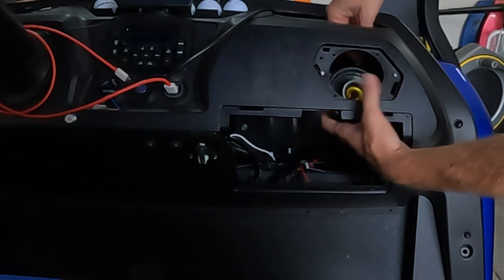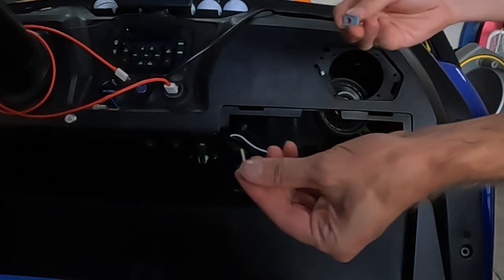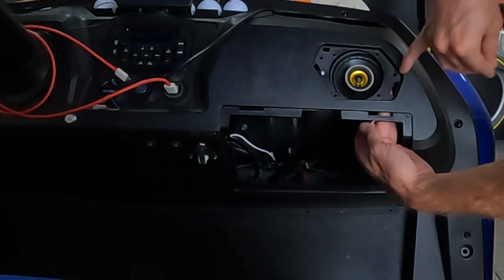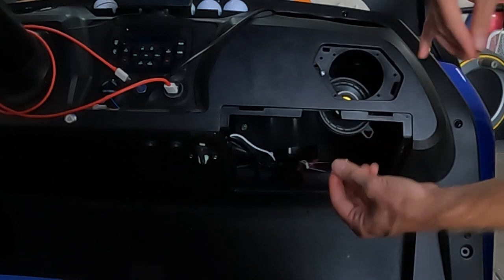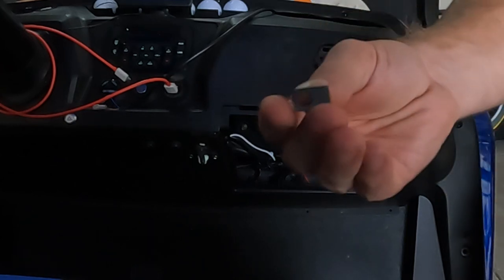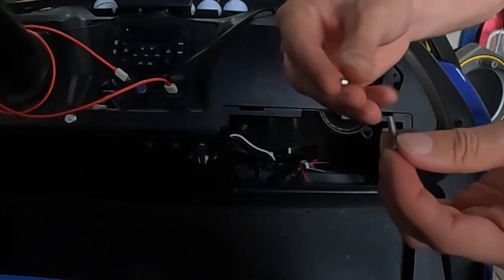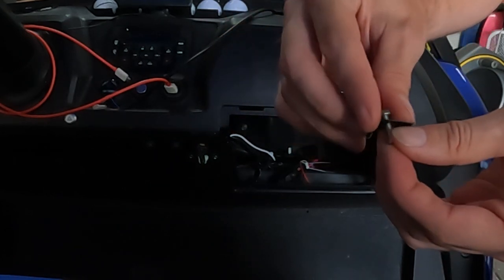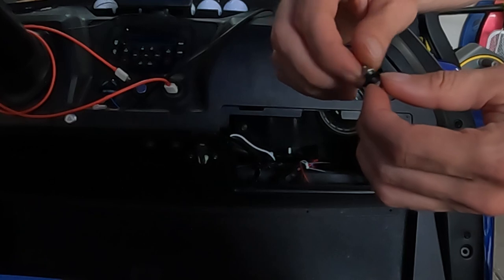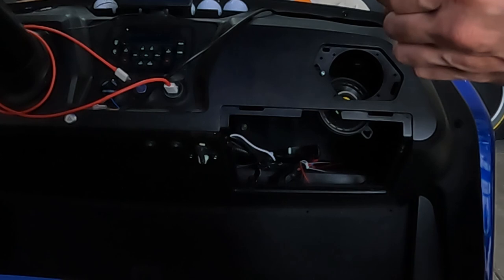What I did here: I have the screw and I rear-mounted the speaker. This is the hole that's already there. So the screw goes through the dash, through the speaker. I broke the clip in half that comes with it intentionally, just so I could use it as a washer, and then put one of the factory nuts right back on top of it. You could double-nut that if you want, just to make it extra tight. I've run this thing around for a couple hundred miles and not had it come loose.